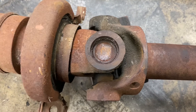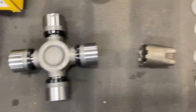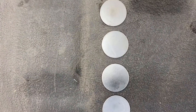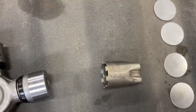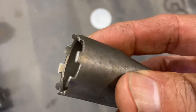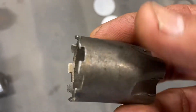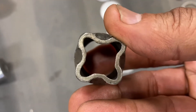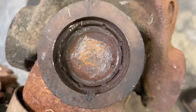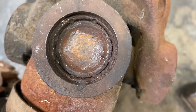I got the part — it's a Precision universal joint. It comes with some extra parts: clips, spacers — you will need these spacers — and a little tool. This tool is supposed to fit into the grooves on that staked u-joint, and with a half-inch drive ratchet, these things are supposed to fit into the grooves and kind of shear them off.